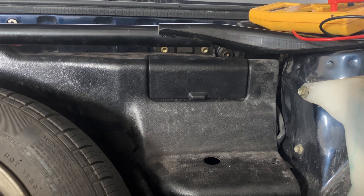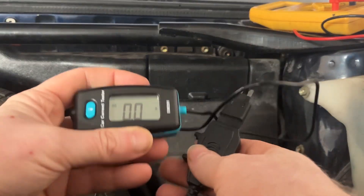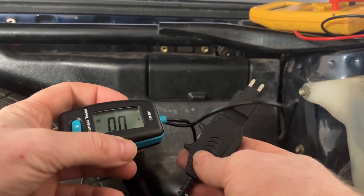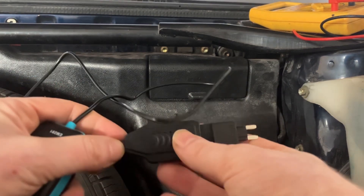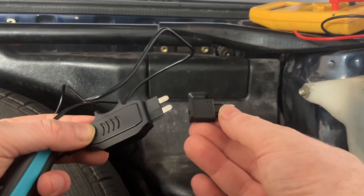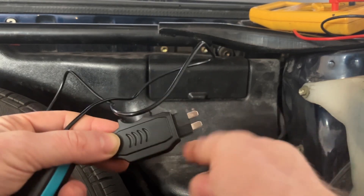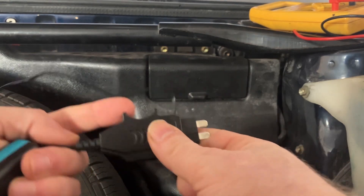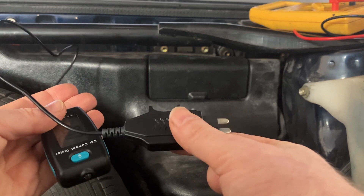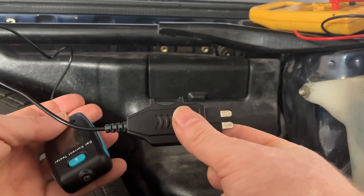So how can we test the circuit for how much amperage it's drawing? The easiest piece of equipment is called a fuse buddy, or a car current tester. It will do up to 30 amps. It's the easiest piece of equipment to use — you've got two different types of spade fuse: the big one and the little one. You put the original fuse into it. These are not a lot of money — about £15 — and this one will do up to 30 amps, which is enough for most circuits apart from the main ignition ones.